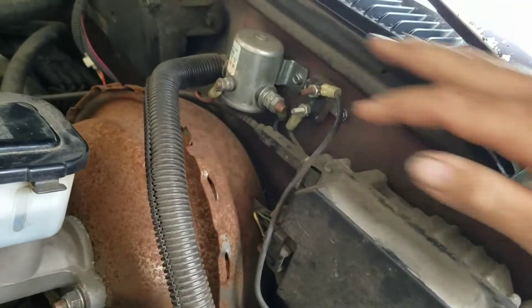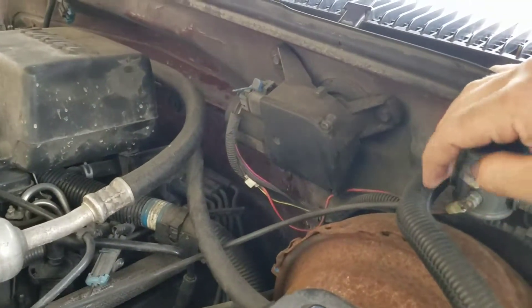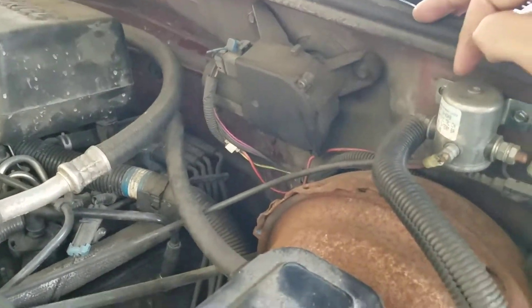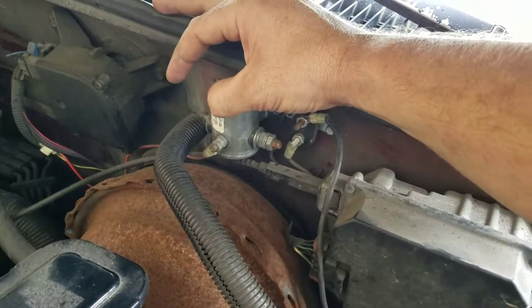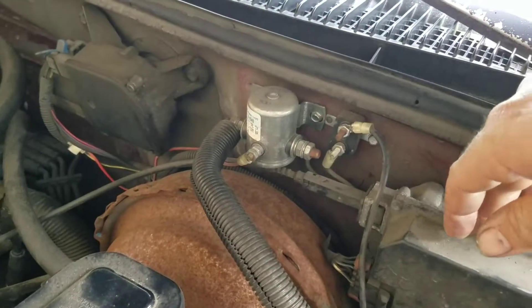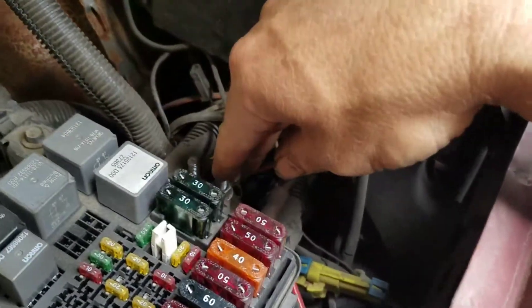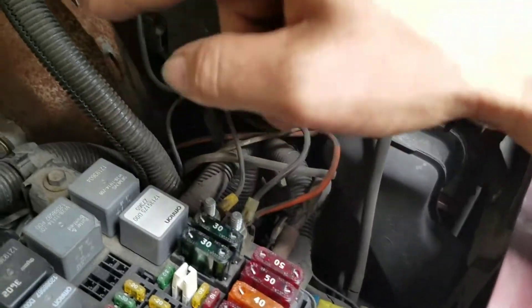It hooks in here. This has some kind of weird wiring going over the wiper motor. I'm assuming so that when he powers the truck on, it turns on this relay so it'll charge the battery. This has two terminals running back to the back so it could power the camper. The other one coming up here — the fuse is blown, so no power is going through.